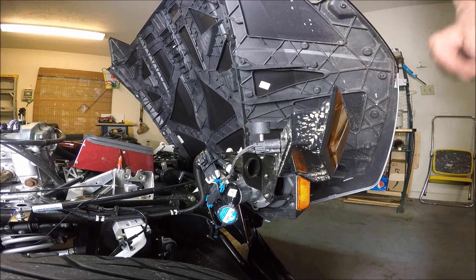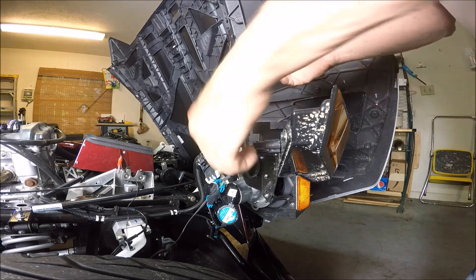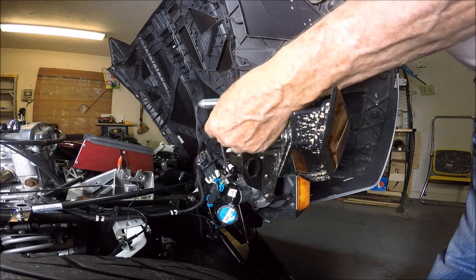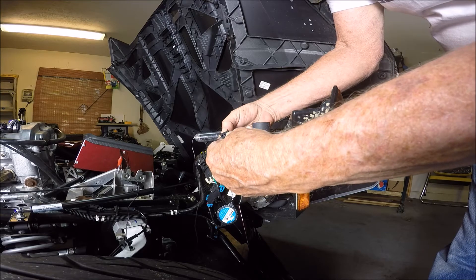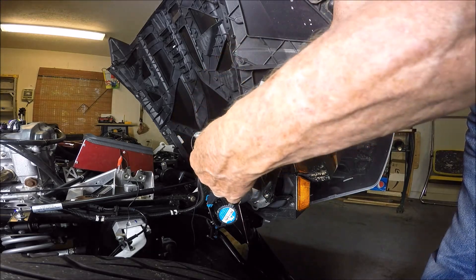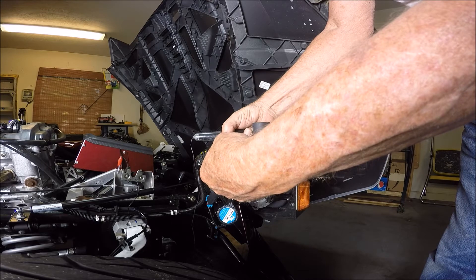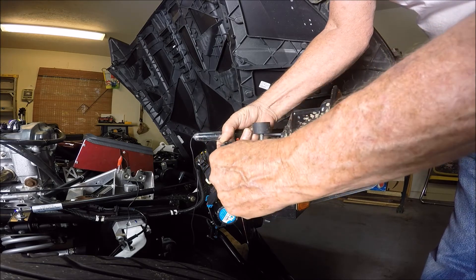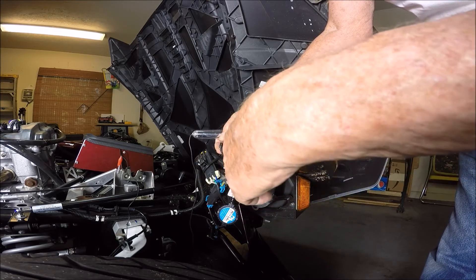With the shop manual I was able to determine which wires we want to look at for connecting to. I'm going to unplug the turn signal plug on the right-hand side — you'll notice there are three wires. Terminal number one on the right-hand side is a blue wire with a pink tracer. When the right turn signal is turned on, battery voltage — a plus voltage — is applied to this lead.